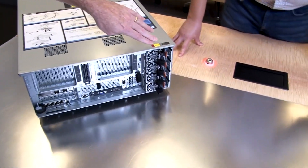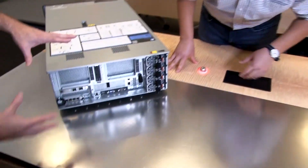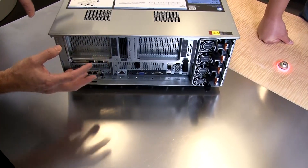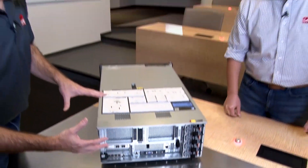At the back of the server, there are four hot-swap redundant power supplies. In this configuration, we have 1800-watt power supplies, and for lower-level configs we can go down to 750-watt power supplies. They are N+1 redundant, so you can have one go down and still have the system remain functional. The majority of the space is consumed with rear-accessible PCI slots — PCIe 3.0 x16 or x8. The server supports up to 14 PCI slots in addition to the OCP. One of the main benefits is that it supports GPUs — up to eight single-wide GPUs can be configured.